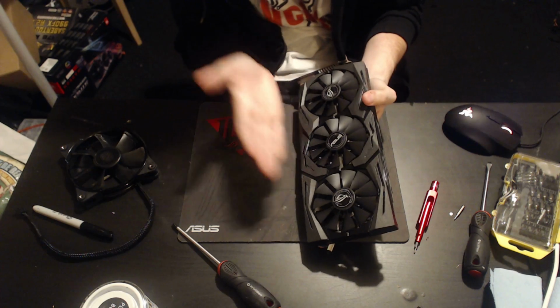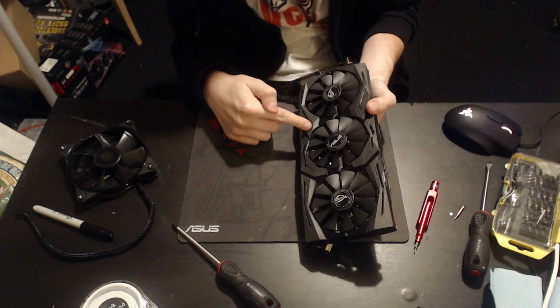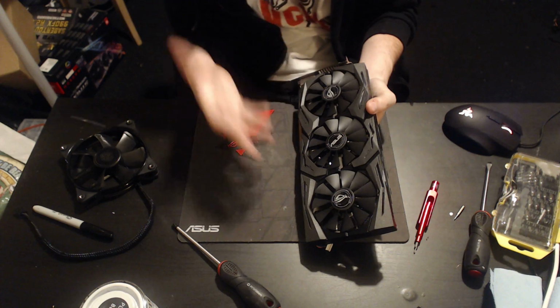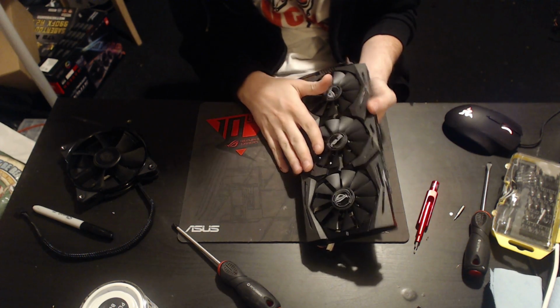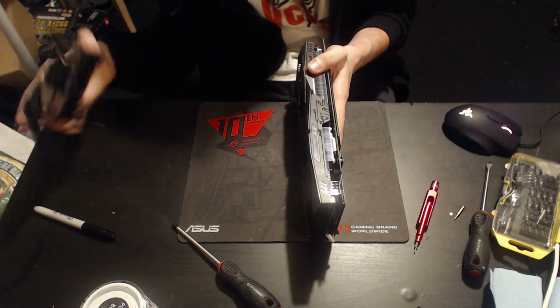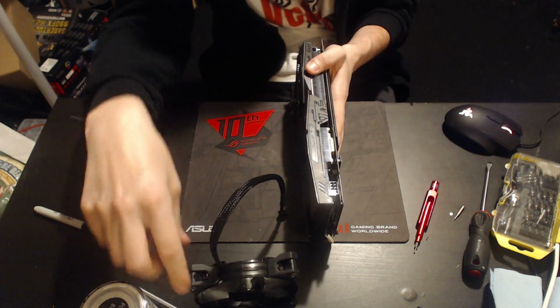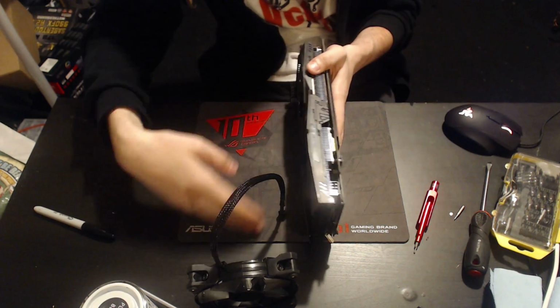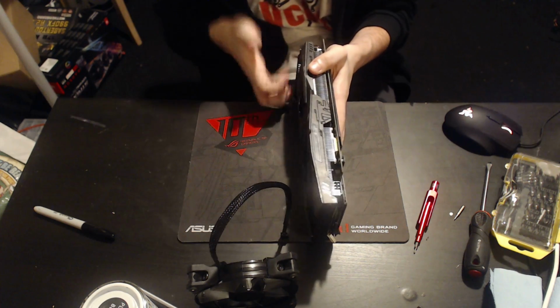So basically you get that recycling of spent air, and the heatsink does perform worse because of it. So if you want to get optimum performance out of this kind of heatsink, you can gain quite a few degrees by putting a fan sort of in this area, or at this end of the card, to blow any of the hot air that's getting stuck in front of the card this way and get fresh air in front of the card.